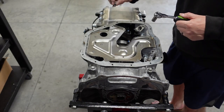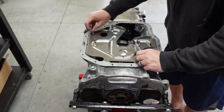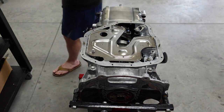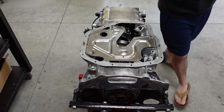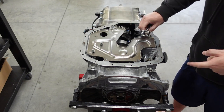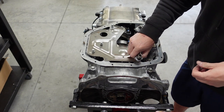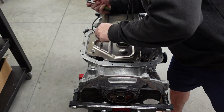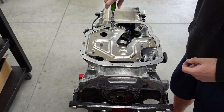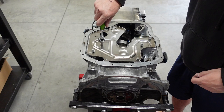Next up we've got to put the baffle plate in — it takes these 10-millimeter nuts, I think it's 78 inch-pounds. No Loctite or anything like that is specified in the book. Just going to get everything lined up and crank it down. But I noticed it looks like a bolt was snapped off years ago in here — that's not good. I guess I never noticed it before. It shouldn't be a problem because there's enough bolts holding it, but it definitely bothers me a little bit.